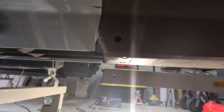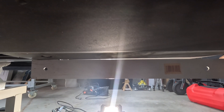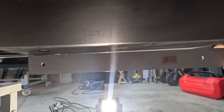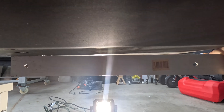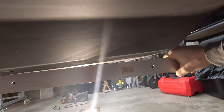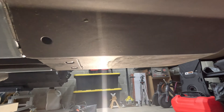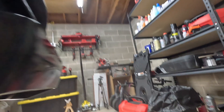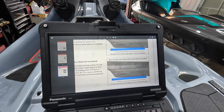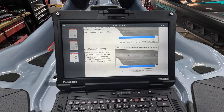That's essentially all you're doing here to find out if your ride plate is affected or not — rest the straight edge up against the front and look for light. If you see no light at all, that means your ride plate is affected. Or if you notice some light in the back, no light in the middle, and then some light in the very back, that means you also have that bulge and you probably need to make an adjustment. Now that you know what to look for, you can check it on your ski. I'll also post the service bulletin in the video so you guys can see what to compare to.